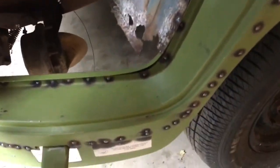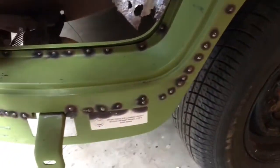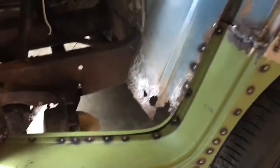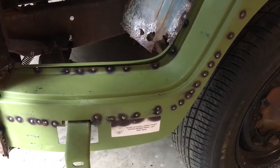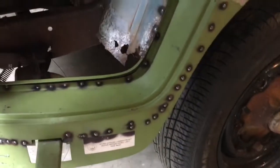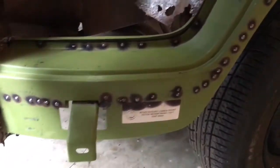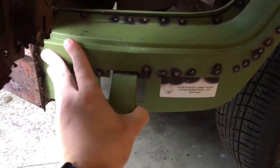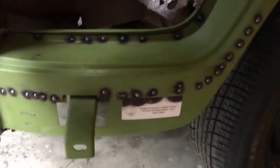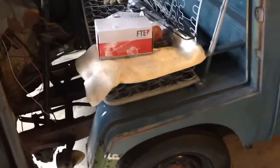Here you can see the dog leg sections. As for all these welds you see — looks like some kind of pleating on 90s jeans — I didn't intentionally plan to put that many in, but it turns out my heat settings on the welder were not hot enough. I wasn't getting enough penetration between both pieces, which produced the evidence of riveter Annie here. I haven't actually welded the bracket because I want to get a bumper first to see if I need to adjust it up, down, in, or out before making it permanent. But driver's side inner and outer dog legs are intact — I just need to grind them down, and I'm pleased with how they went.